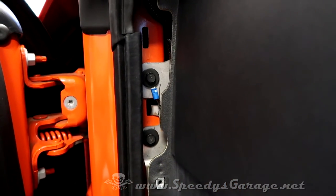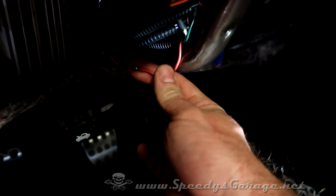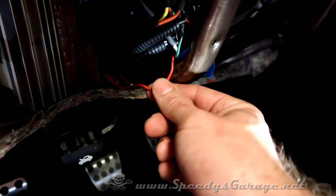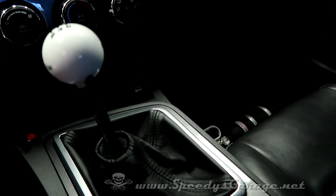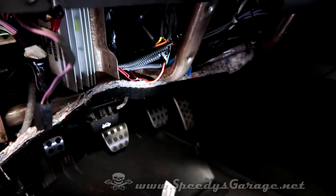Come back and hook up your ground and finally hook up your switched 12-volt. I'm using one of the leads from my circuit boss. I like that solution because it keeps all of my aftermarket circuits completely separate from the car systems. Also, the Challenger doesn't have very many switched 12-volt sources to begin with — the only other one I'm aware of is your power plug. You can get switched 12-volts from that if you don't have a circuit boss.